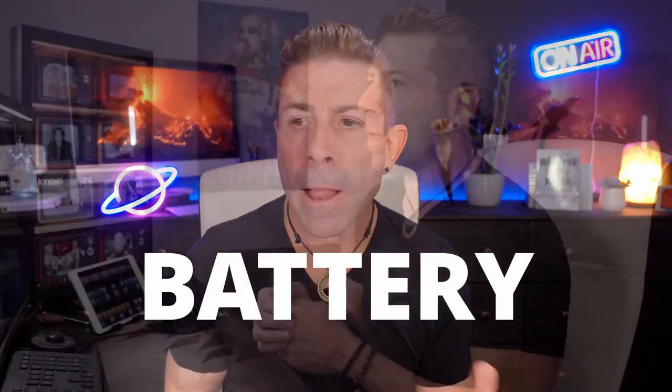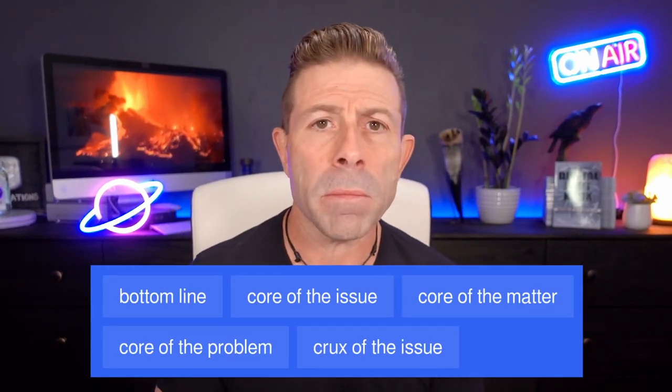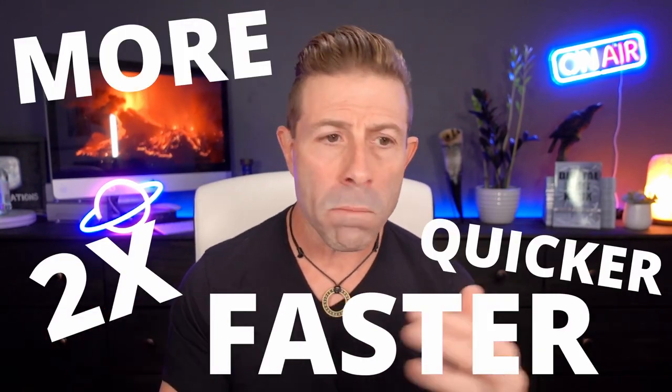Now what didn't double — and this is one of the issues — is the battery. The battery is the exact same 1720 milliamp-hour battery. So what happens is when you take a battery and pull more juice out of it, it produces more heat. We have the same battery but now we're trying to get so much more out of it with the new GP2 processor. That really is the crux of the problem. We're trying to do double the amount of things faster, but we're not giving it more power — so it's shortening battery life and producing more heat.